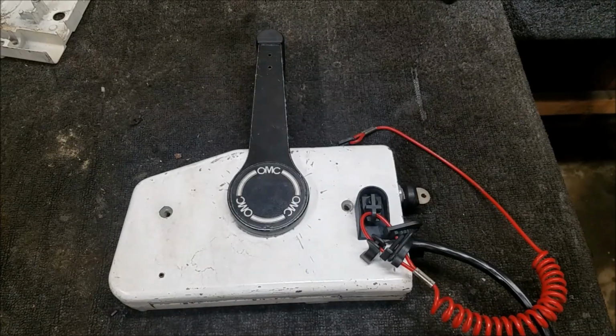Cool. We get our longer screws. That's how that handle should come off. So what I'm going to do is wire wheel this spline up real quick. That's done. Didn't really look like it did much, but may have. So I'm going to put some of this triple guard grease on these splines because I don't want to fight getting this thing back off ever again.